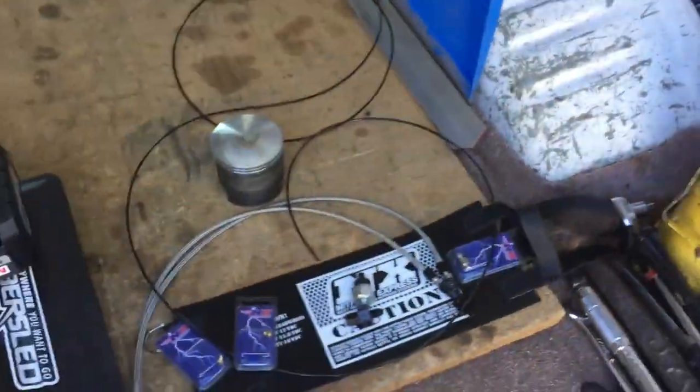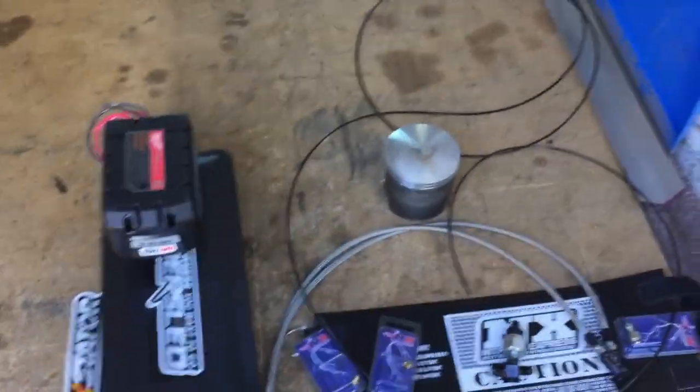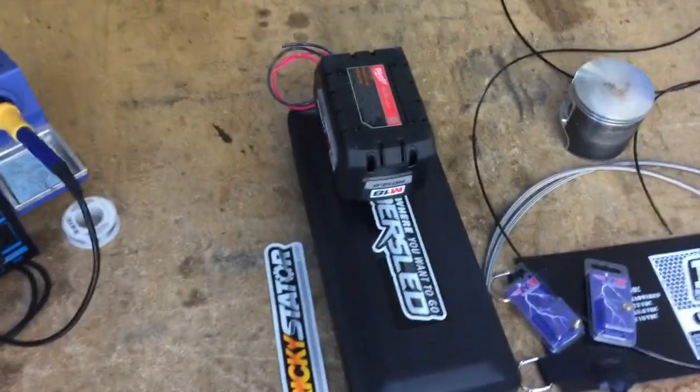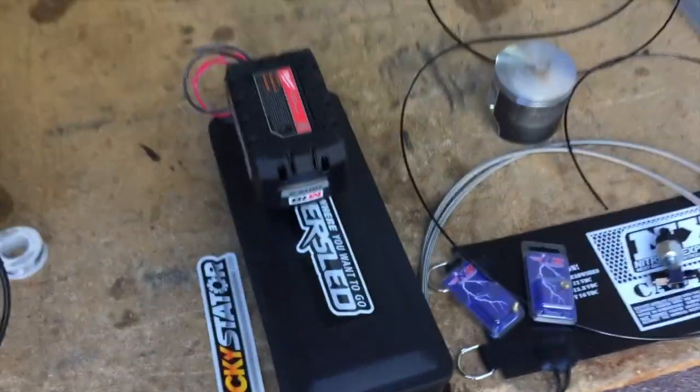On the side of the manifold fitting will be my pressure gauge — I think it's zero to 1300 or 1500 PSI. Here's the Nitrous Express shark valve. Instead of running big 3AN lines, I'm going to run female push-lock eighth-inch poly line. It came in a really tight roll so I've been trying to straighten it out — hung it with vice grips in the sun, similar to how you'd straighten poly irrigation pipe with hot water.